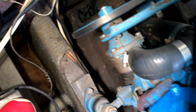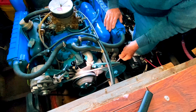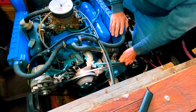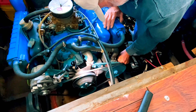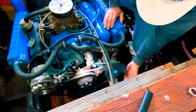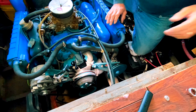Okay, now looking at the motor, this is the pump right here, and those are the hoses we're going to mark. The first thing I'm going to do is loosen the tensioner bolts – there's one on the top of the slide and a second one on the bottom – so that I can take this fan belt off. You really can't get a socket in there, so you just kind of loosen them a little bit, and then you can see the pump comes pretty free. Pull that belt off and push it up out of the way. Now this baby's loose, so we can take off the hoses.